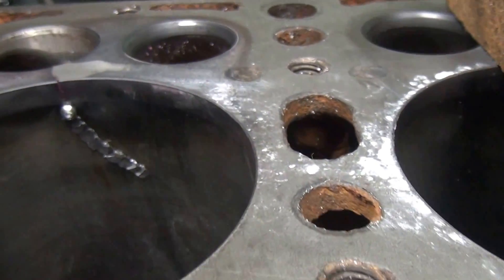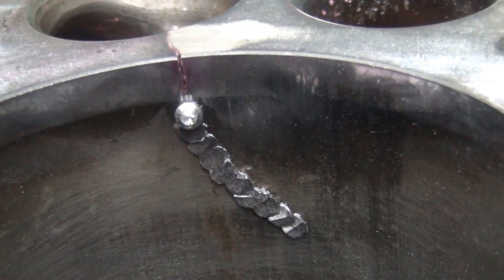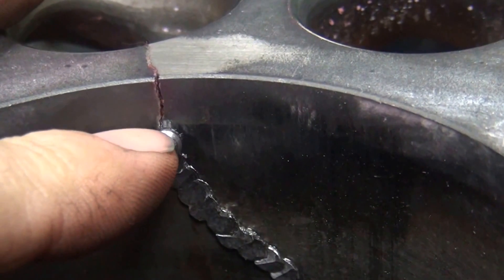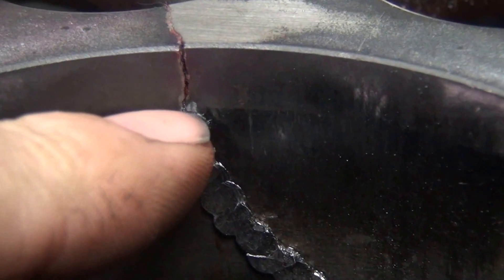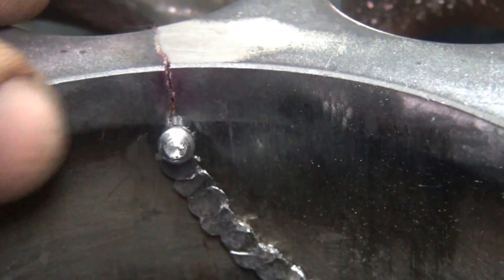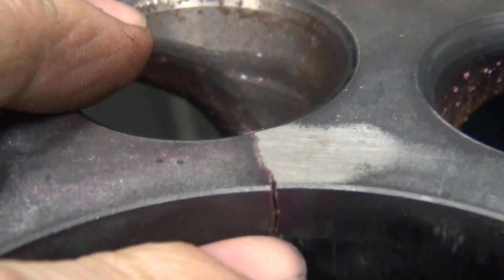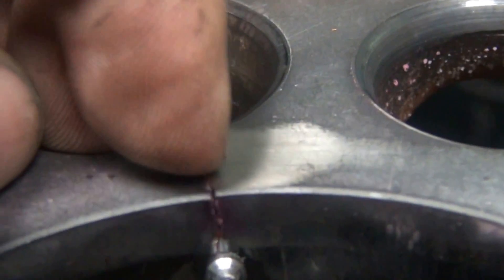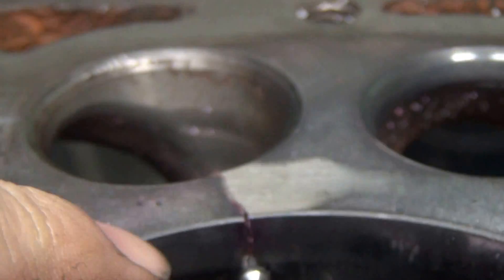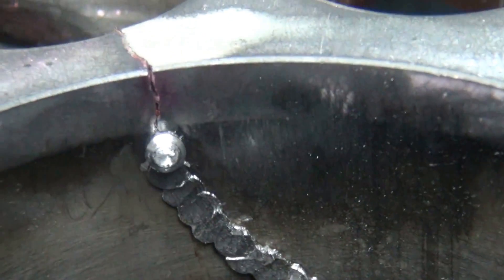We're back repairing the crack on this model A B-block. I've done about five or six pins up top here, and right now I'm up to about where the thickness of the deck is. You can see the deck right there. I'm thinking about switching over to the other style pins to see what that's going to do. We're going to have to drill at an angle because you can't overlap your pins — this one at an angle this way, and that one going the other way, so it should stop it.